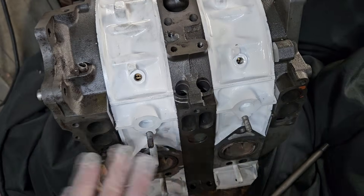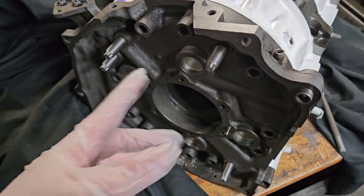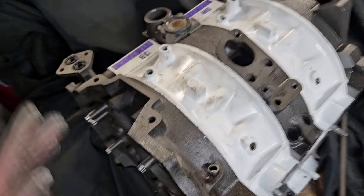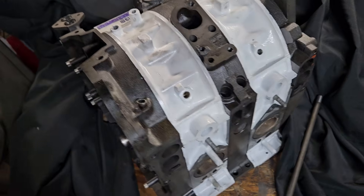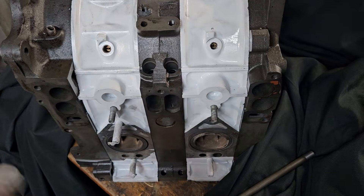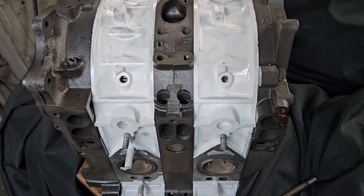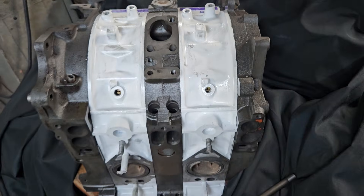So I think that's a wrap — cool little block here. Customer sent it in, we did five studs on it, he's going to run some boost, he's doing the porting, we lapped the sides. This one's got a whole new life ahead of it in a whole new configuration. I'm always happy to see people having fun with rotaries, and this is definitely somebody having fun. Thanks for watching — let us know what you want to see. We're always talking rotary.